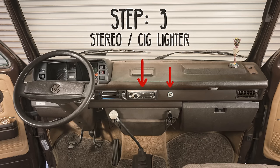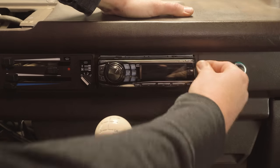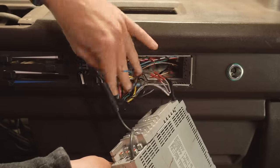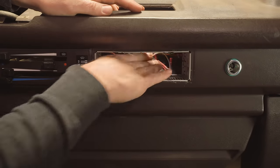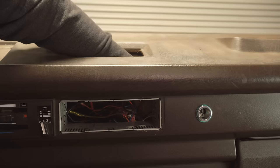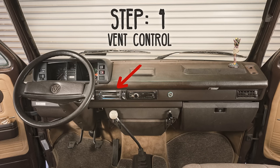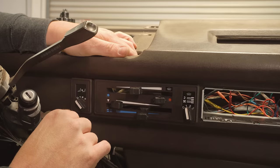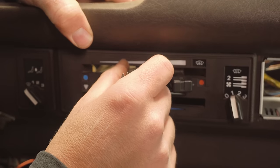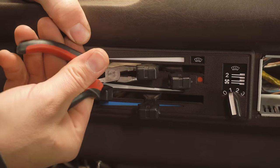You'll need to remove your stereo as well. You can access your cigarette lighter through the ashtray — you'll want to reach around and unplug that as well. Next you want to pull all four of the knobs from your vent controls. Be very careful as these can become really brittle. Avoid pulling on the end of the knob as they often break off. If you can, use a pair of needle nose pliers to pull on the flat part inside of the knob.